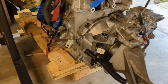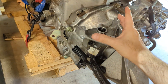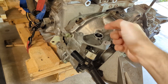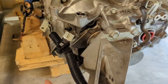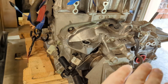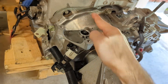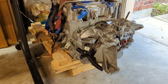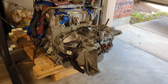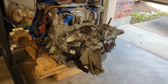It's got this little black motor — you can probably see it in any images you look up. It turns the shaft and down here at the bottom, it moves a little slider that kicks a lever into the path of the motor input shaft. When that kicks in, the motor input shaft is locked from turning, just like whenever you go into park on any automatic transmission.